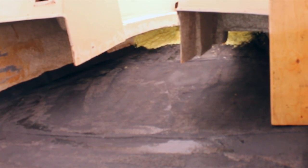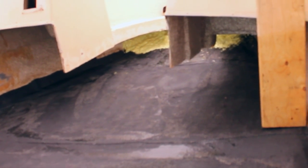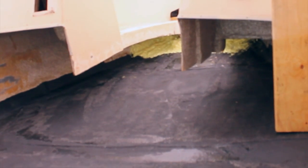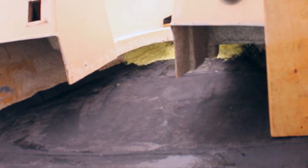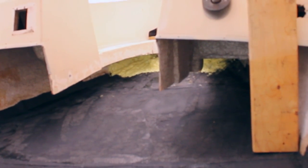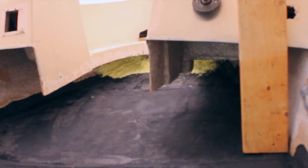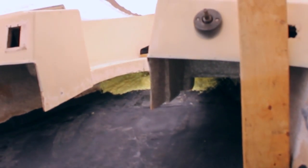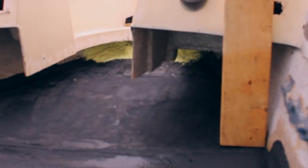Had put some expandable foam, that Great Stuff, in there. Really had a difficult time pouring fiberglass resin up in that area. So after I got the resin hardened and the blankets nice and as even as I can get them, I sprayed some Great Stuff in there and used a pair of rubber gloves and my hand to flatten it and fill in any gaps that I could feel around the edges and the sides. So pretty confident with that, happy with that.